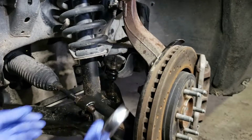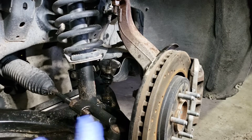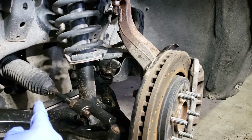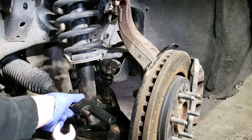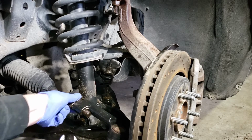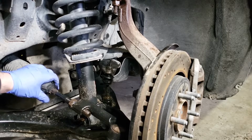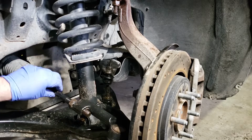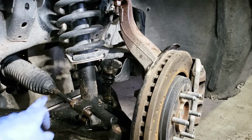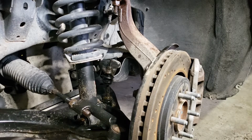Oh my goodness. She goes. Now because it's pointed this way, I need to thread the tie rod end this way to pull it. So I'm going to loosen this up a little bit. And you should be able to twist this, which interestingly enough looks loose. I don't know what size this is. I'm guessing it's like a 12, maybe 13. And then you should be able to just spin that to thread this in, which should pull that way. So I'm gonna grab a wrench.